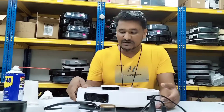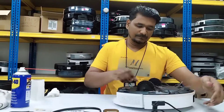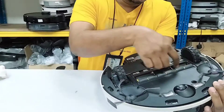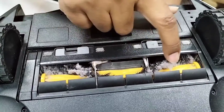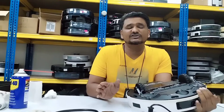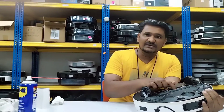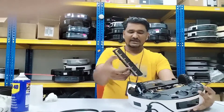Yes — the tissue paper now starts flying, which means the airflow is there but not very strong, because of the filter condition I already showed you. Now about the grinding sound — you can see here: all the dust inside is stuck with the brush. If the dust sticks to the brush like this, it confirms 100% that the brush is not turning — maybe the brush is jammed — and that's why all the dust sticks here instead of going into the dust box.